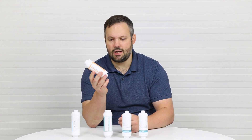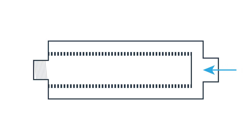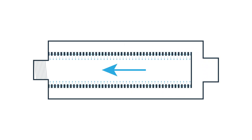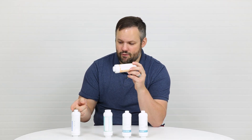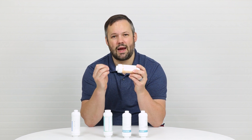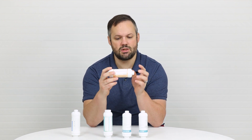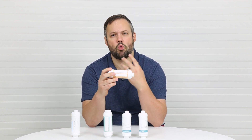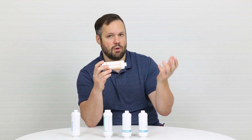This filter is a sediment filter. It has a porous material in it that the water has to travel through before it makes it to the bidet. This allows you to remove minerals that would otherwise clog your bidet seat over time. Now unlike the carbon filter, this filter is not going to remove organic substances from the water — the carbon attracts those. This is going to remove more of the minerals from the water, preventing buildup in the seat.